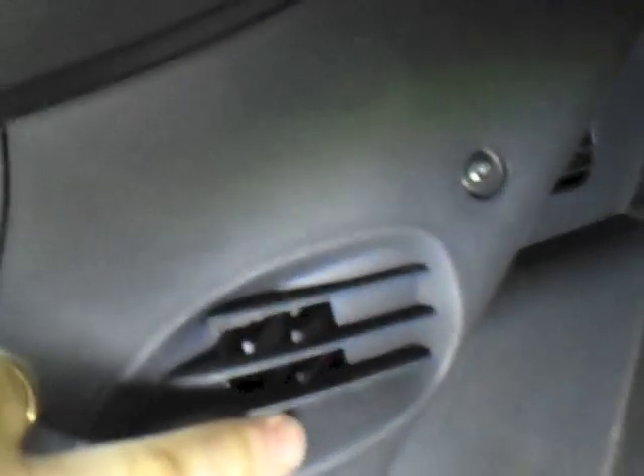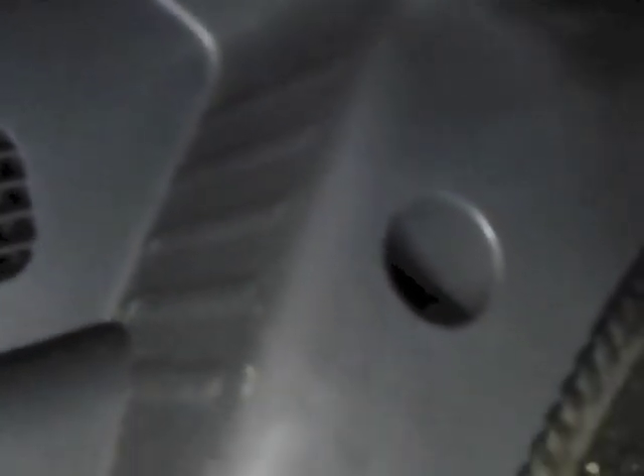On this side you've got the kick panel — it's a large kick panel. There's a bolt just there, another one in that hole, and then that little one there, and then that piece will come off. There's a screw up there which holds this piece onto this piece, and once that's undone the front section — the centre console — will come out. There you go, that kick panel's off. Hiding behind there, behind that little sponge, you'll see the blue and green of the plug — that's the airbag ECU, which is much more accessible from the other side. That's one of the last things we do.